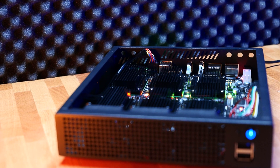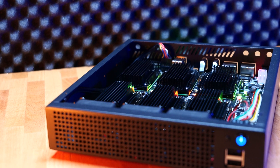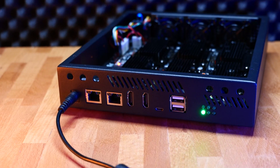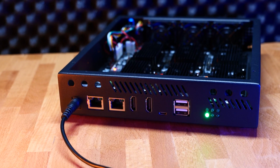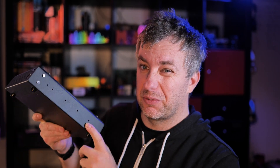If you purchase the case, apart from a metal enclosure with a nice access hatch for storage and a top hatch for the modules, it comes with massive heatsinks that definitely improve thermal performance. The front IO includes a power and reset button and two USB 2.0 ports, and there are slots at the back for wireless antennas if your CM4 has a wireless module. On the side you'll notice screw mounting holes, probably for rack installation. The fans could be upgraded to four-pin fans for proper PWM control, but you'd have to change them yourself.